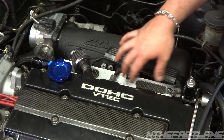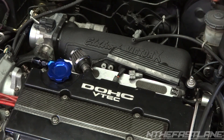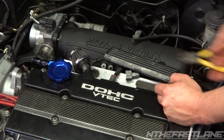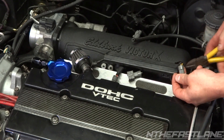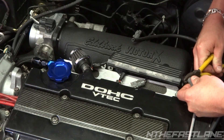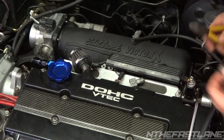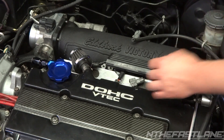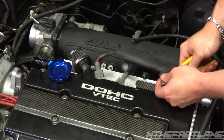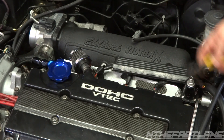First step: we're going to cut the wire clips on the originals. Before you do that, make sure you disconnect your battery because there's a ground and a positive and we don't want them to make contact. We're going to cut them as close as we can. I'm not going to be reusing these, but if you are, I suggest cutting them a little bit off the clip itself.